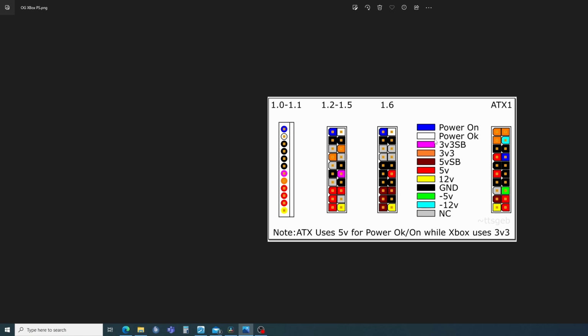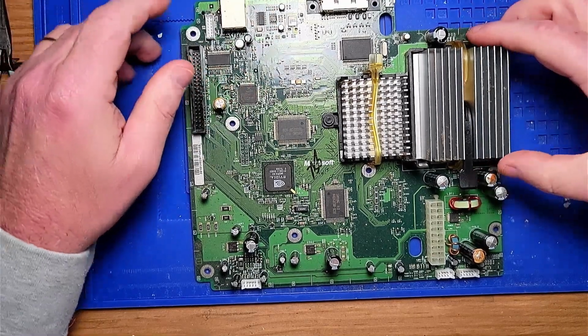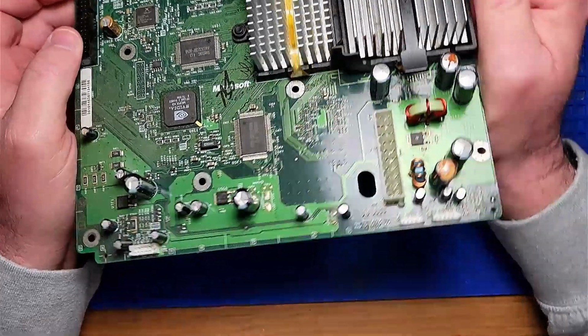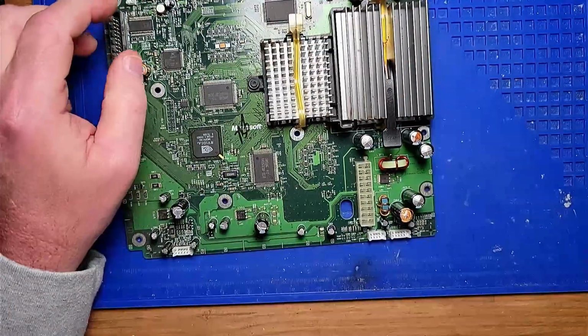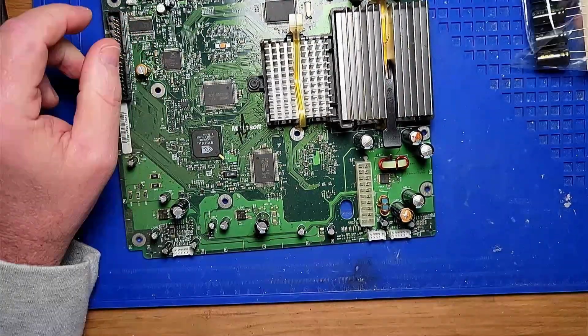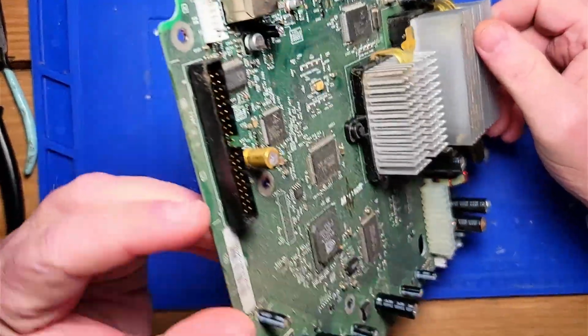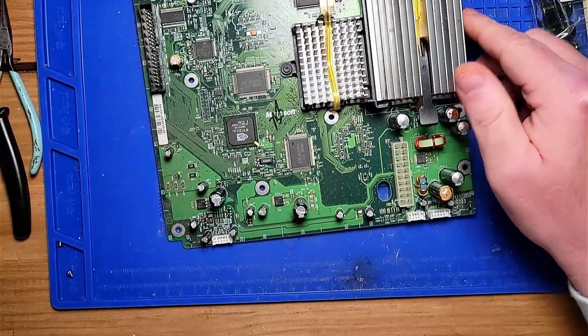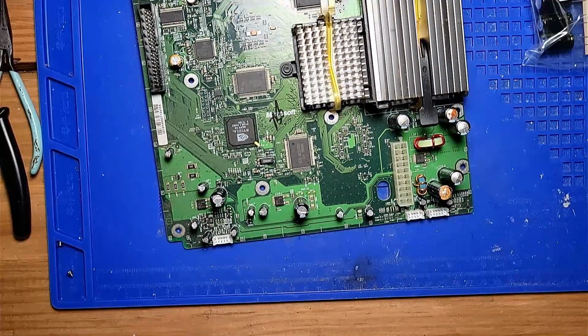And the reason I was missing that was because those CPU capacitors that I'm going to be changing here in a sec as you're watching the video, that was the whole problem the whole time. And so let's pick up with me changing caps. Alright, so we can see these capacitors are not doing so good. So we are going to change them. I ordered a total of 6 of these. I think they're either 3300 or 2200 microfarad capacitors. So we'll go ahead and get those out.